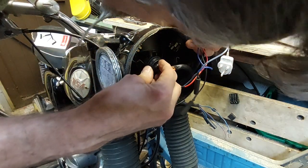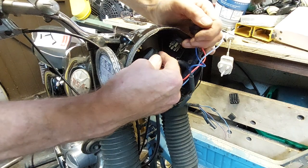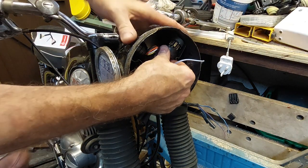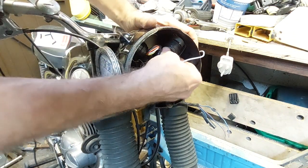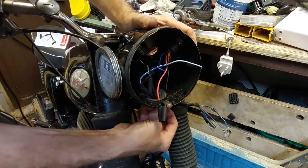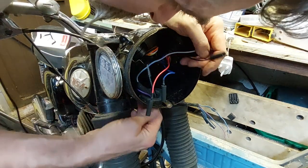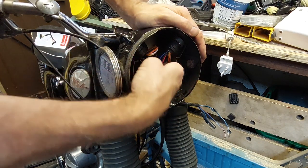And then we look to see where the blank area is, there, that goes over that sort of cut down number 10 pin, and then push it on. Okay, pop in the lighting one that way. One more. There we go, it goes home. And that loom sits nicely at the back of the headlight cover. Yeah, that fits quite nicely, allowing room for the headlamp shell, allowing the headlight to go in without pulling all the wires out.